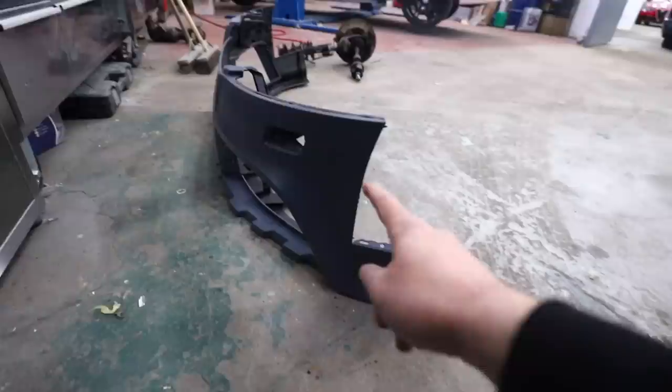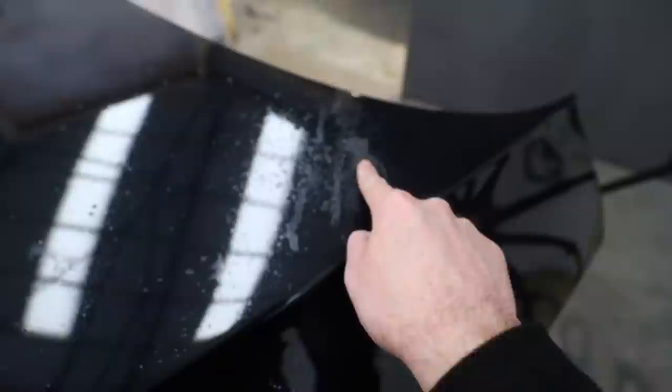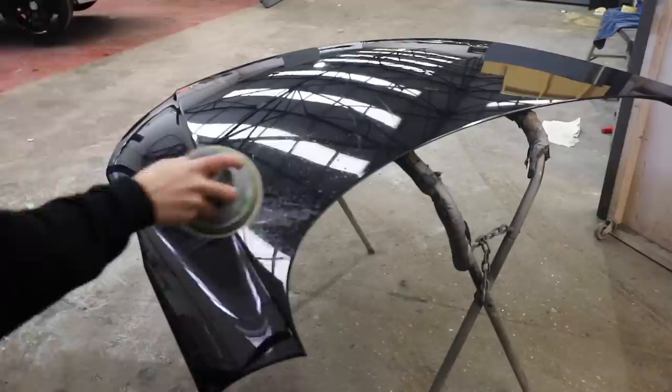The bumper is now prepped - that's a pretty easy one. Because it's a brand new bumper, it just needs a light scotch and that should be good to go. But the bonnet, that's a slightly different story. Because this has been stored underneath another car, getting scratched at the auction place, it needs painted over the whole thing. And it also needs some damage repairing from where it's had brake fluid drip on it, which has caused a reaction in the paint.